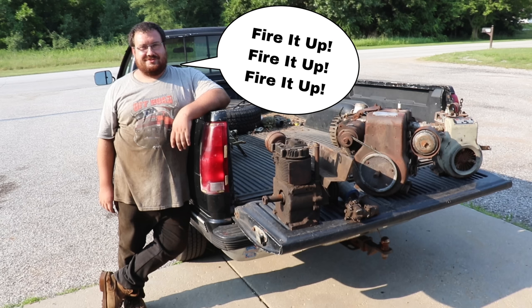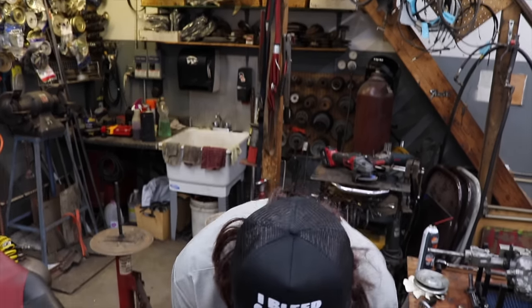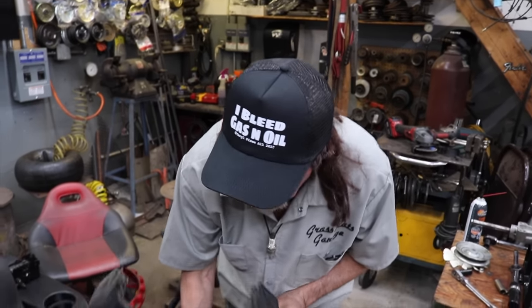We can't move it. Because when that parking brake system goes bad, even when you release the hydraulics on it, because it's got those release levers, you still can't move it because the parking brakes are on. So I asked Elkskins, because he's always hanging around here, can you go pick that thing up for me? And he went out there, and he had to get under there and manually release the parking brake from underneath. And then he had to pull the blower shroud off.